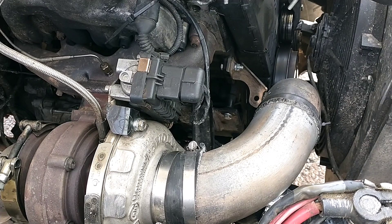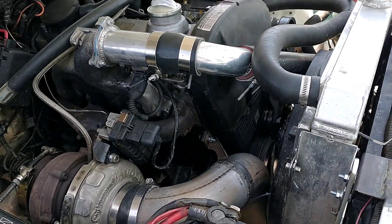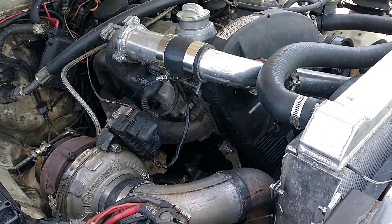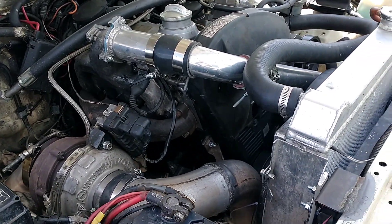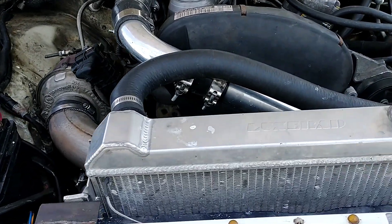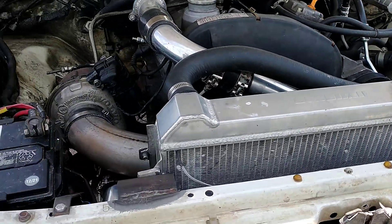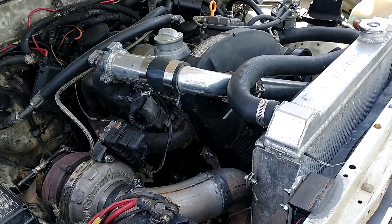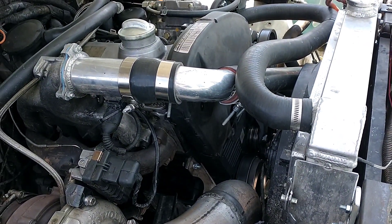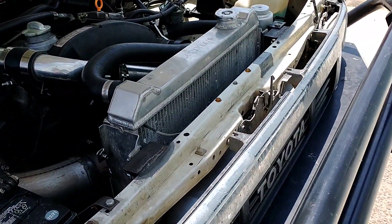Tuning this turbo, we bent the rods hitting almost 42 pounds of boost, so I think we're pretty safe at 36. We're limiting it to — I think it's 2500 RPM, I might bump it up to 3000 RPM — where it limits you to 25 pounds of boost, just to be safe and be able to run higher horsepower without building the engine internally. Anyway, we've got to be over 200 horsepower with the 240s, though it's not going to be too much more, but it sure flies for what it is.